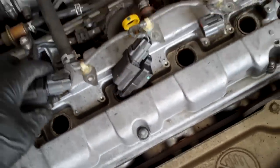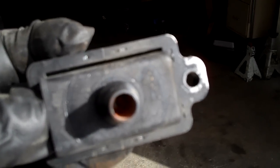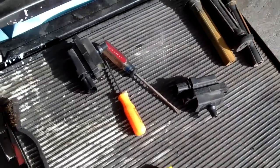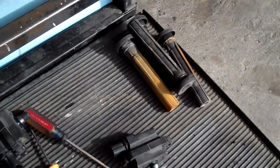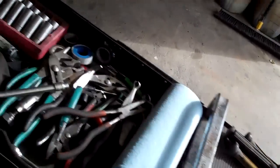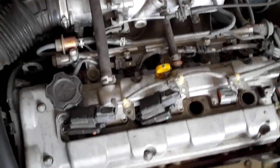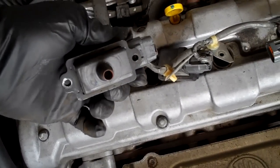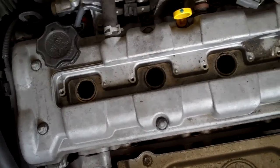When you look in each and every one of these ignition coils, you'll find there's a little screw in there and it's just badly rusted. So if you have a great deal of resistance right at the coil, it's no wonder. It didn't show any misfire codes — I think it was consistent across all four of them and the knock sensor wasn't able to determine which was misfiring, but rest assured it was. So I may have to pull those screws out and replace them, if not replace each of the ignition coils.